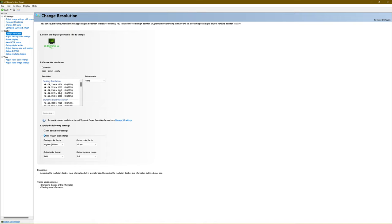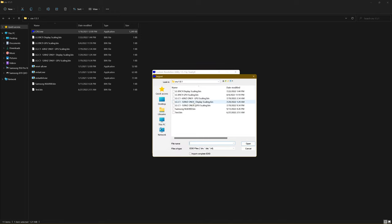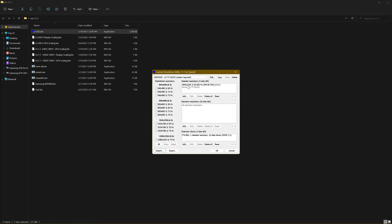Display Scaling, on the other hand, sends the raw resolution to your display and the TV uses the internal chips you paid for — that's the whole reason you bought the television. You have eight-core processors and all this stuff inside your TV whose job is to upscale for you. Most people hook consoles up to their TVs, not PCs, but it works with PC just the same. Display Scaling gives you a really beautiful image with zero input lag. The only downside is it only works within a few resolutions: the TV can upscale 720p, 1080p, and 1440p — you could probably add 480p as well.